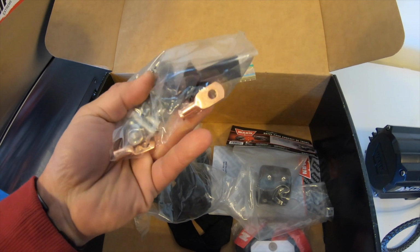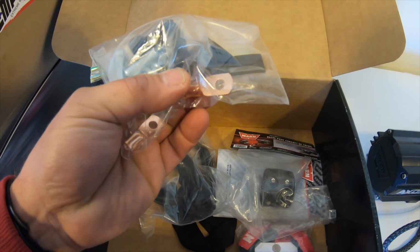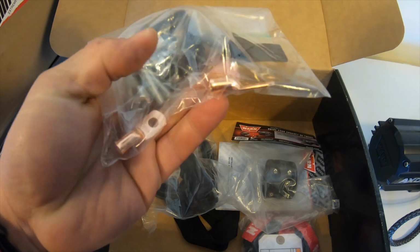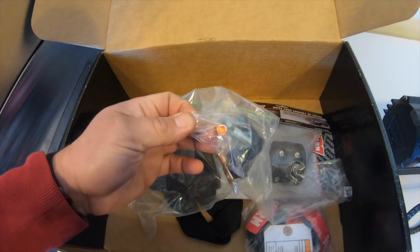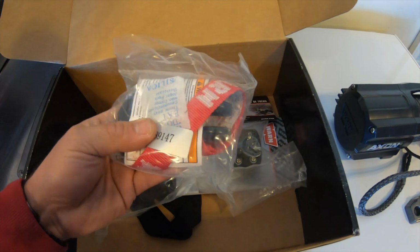And I've included some 6-gauge terminals there that will need to be trimmed back a little bit because there is limited clearance. So those have to be run through the grinder if they have to be utilized. And a hydraulic crimper is also advisable for putting that onto the wire if you need to shorten it. And then they give you the hook.